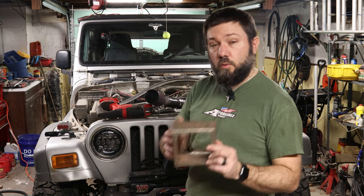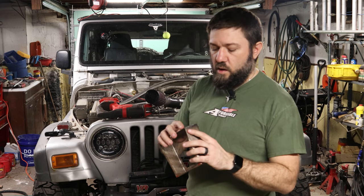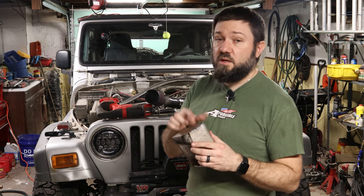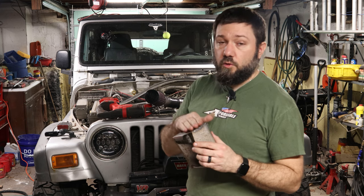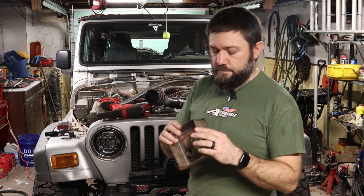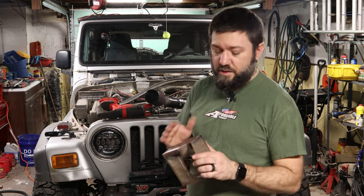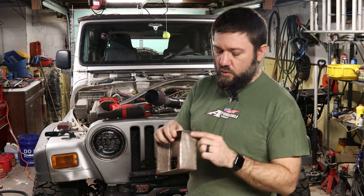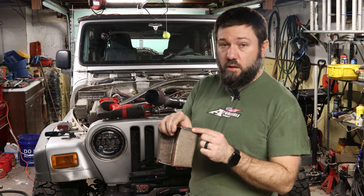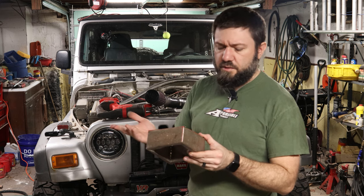This is still proving to be difficult. So my next thing is, I mentioned I want to try to weld it. Welding did not work so well on this, mainly because my welder is set up for much thicker materials. So if you're going to try to weld it, you're going to want a welder that's designed for thinner materials, maybe a TIG even. The Yes Welder with .035 wire in it, because that's all I've got, just didn't do the job. It's holding, right? I was able to get it to hold, but you can see it burn through. I don't know if you can see that well on the camera. What I'm going to do is probably paint this next and then let it sit overnight, and maybe I'll get back to this tomorrow.